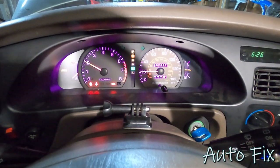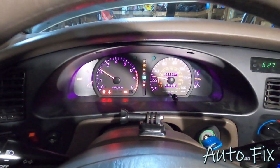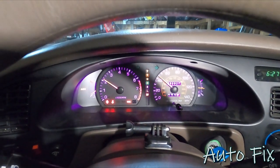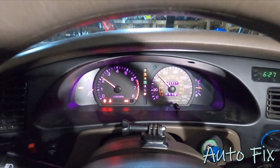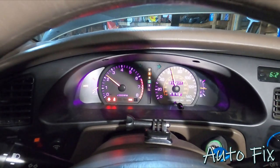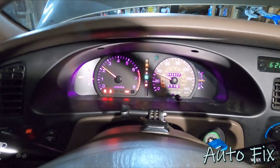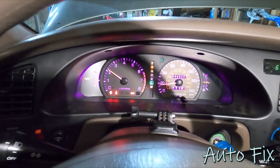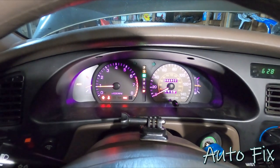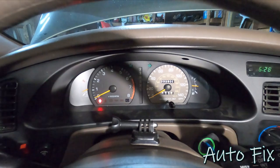Second. With the car in second, I'm going to turn off overdrive so that it does not shift into fourth, just third. Once you shift it into drive with overdrive off, it'll shift into third, not fourth. There we go — that's third. We're going a little bit scary fast here, the car's shaking, but keep on going. So that's overdrive. Let's slow it down — downshift to third, downshift to second, and downshift to first. Bring it back to neutral. Don't forget to slow the wheels down with the brakes, because if you put it in park and the wheels are still spinning, you're going to hear some horrible noises. Now shut it off.